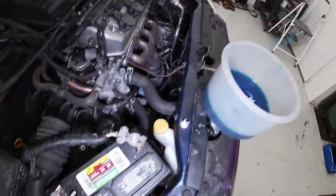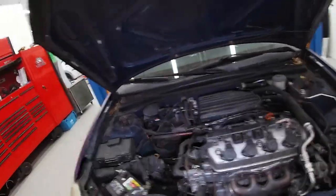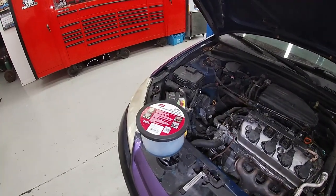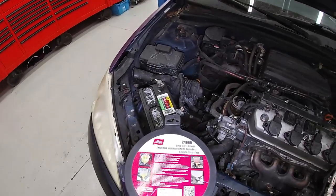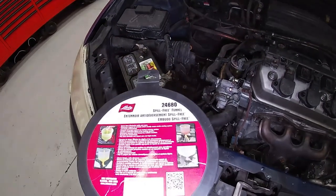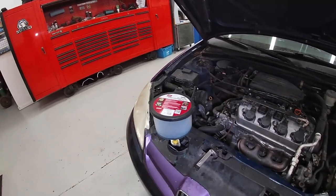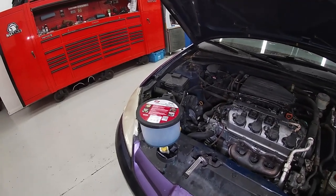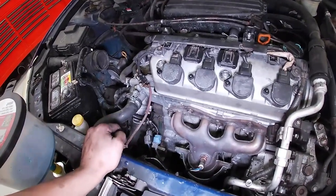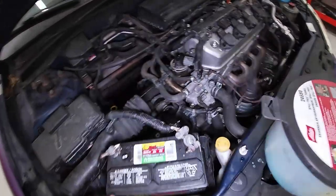Always go through and double-check everything you touched to make sure you reconnected it. If you don't have one of these coolant burping funnels, they're excellent for burping the cooling system — this is a Lisle part number 24680, available on Amazon. It has all kinds of adapters for almost any cooling system and makes the job a lot easier and cleaner. Make sure you start it up and burp the system properly — not just as best you can, it needs to be burped properly.